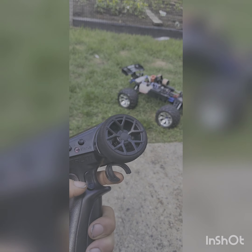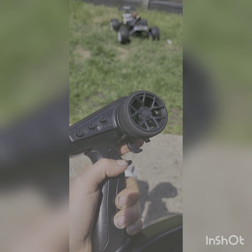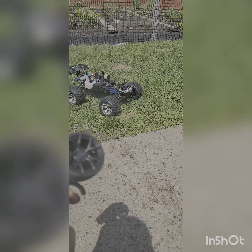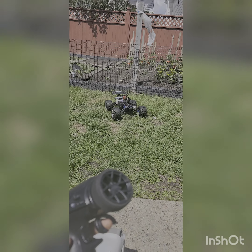How you engage reverse — you have to hit the brake side and make sure the truck stops so you don't accidentally strip the gears out. Same thing with forward. You gotta push the button down, then it'll go forward, then you can let it go — you don't have to hold it. The key is you have to hold it while you're in reverse; it's kind of a safety feature, otherwise you'll strip it out. Once it's actually set in reverse, you can just leave it like that.